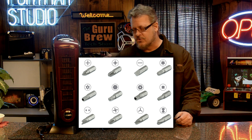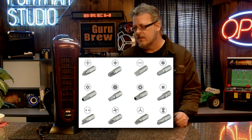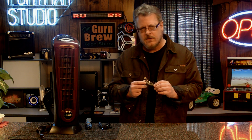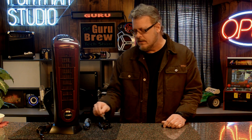Some manufacturers of space heaters also put like a security key on the screws. If you look at the screw head and it's triangle shaped or some other pattern besides just a normal Phillips head, you may need to get like a security bit set like this. I'll try to remember to put a link in the description. You can get them online for like five bucks or you can go to places like Harbor Freight or Sears, but a long screw shaft is probably going to be needed for sure.